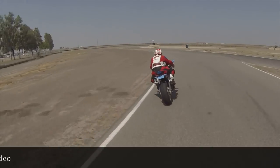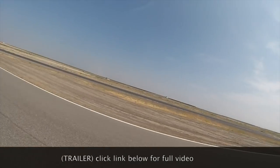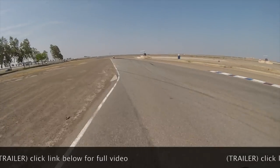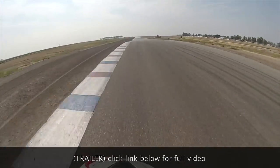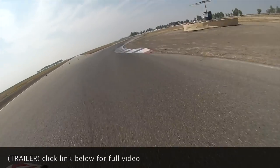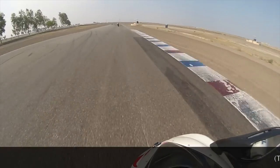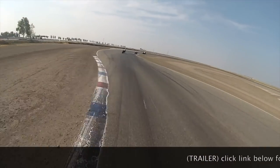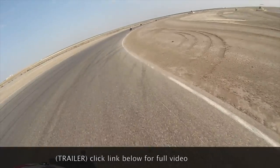Right now we should have 95% of the setup work finished. We know definitively now, given the track temp of 130, that the pressure in the front — we're golden. Let's see how we do with that rear pressure now. With that pressure, I can really feel the front and the rear protesting. So now we're going to open up this contact patch significantly. The question on acceleration is: is the bike going to run wide, because the back tire is going to completely change its shape.